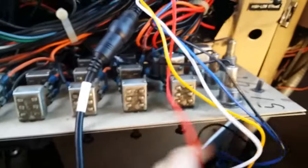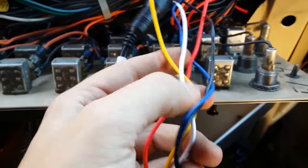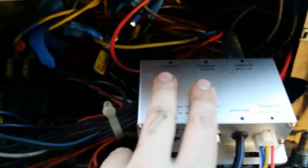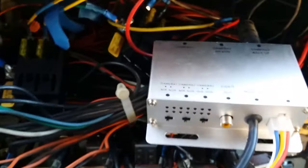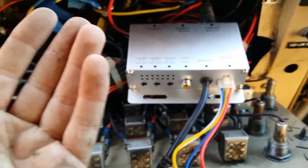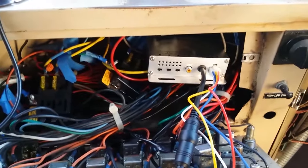I'm going to connect the power wires for each individual channel. The black wire is the ground, red is for the power for that unit, and blue supplies power to channel 3. White and yellow aren't going to be used because I don't have any other cameras. They power these two channels by having the red and the blue spliced together, which is power for this unit and power for that channel. When I pull the switch, it'll provide power to both simultaneously and turn the camera on.